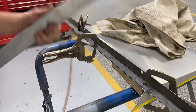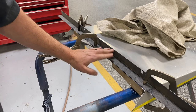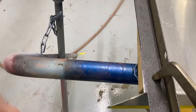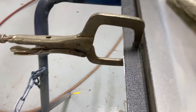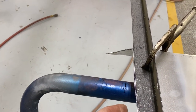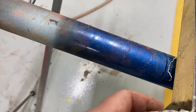I'll be able to file the rest — it's not exactly straight but it's fine. I tried to hold it up against the fence as best I could. Now I'm gonna file the edge straight. You can see how it's hung over a little bit and that's fine — I wasn't trying to make that the finished product, I just wanted to get it close. We've got a little mini belt sander — I don't think many of you students have ever seen it — and I think I'm gonna use that. You can see all the jagged edges but it's turning out pretty good.